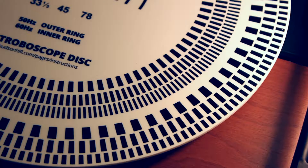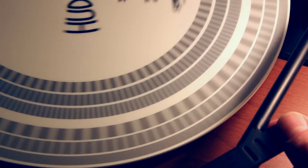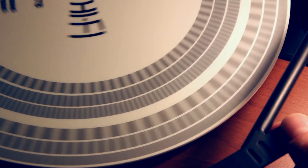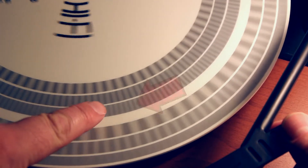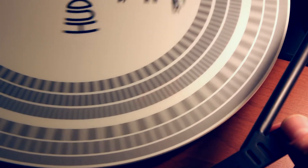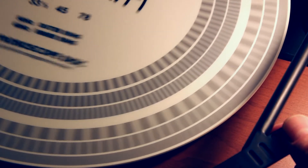What we're going to do next is pretty simple. We're just going to rotate the record player surface, in this case by sliding the tone arm over. You're going to notice a lot going on here, but don't be confused — we're just focusing on that inner ring. There are those three circular areas with dashes that correspond to the 33, 45, and 78 RPM speeds. Right now the record player is set to 33, so we're focusing on that set. You'll notice it's marching a little bit to the left, meaning the speed is not quite set correctly. We're going to use the pitch knob to tune that left or right until we get it right.